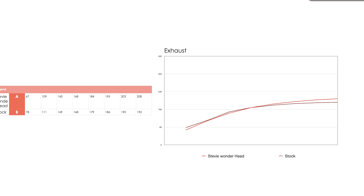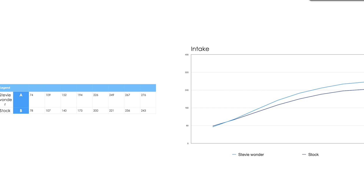Just because there wasn't a big loss in CFM, it doesn't mean that there weren't losses other places in the cylinder head. That's originally why the head came here — it actually wasn't for the porting; it was because the guy couldn't get any power out of the head. We know now that's because of the valve job. The valve job wasn't done correctly — it wasn't done to the oversized valve. The way you do small things is pretty much the way you're going to do everything, and that's what you see here. You went to the wrong guy. The guy who ported it is a Neanderthal — he didn't valve job it, he just stuck valves in. He thought he just lapped them in and they'd be okay, and send it down the road. And then you have a problem.